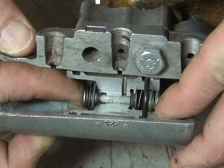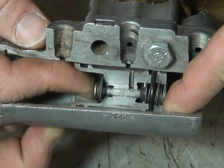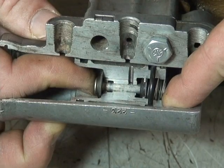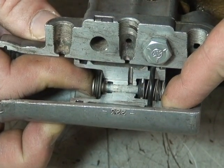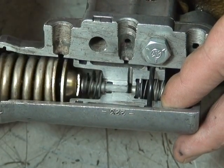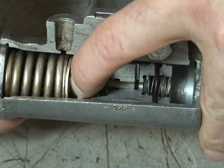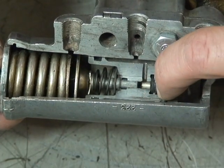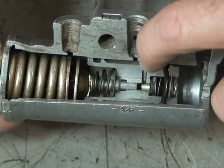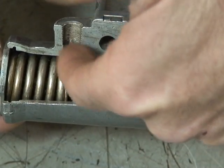Once the air pressure on the back side of the piston — being sent from the supply tank — drops 20 to 25 pounds from cutout pressure, so by 95 psi, the spring now becomes stronger than the air pressure on the bottom of the piston. It will cause the piston to be pushed back down, closing the passage from the wet tank to the unloaders, and opening the passage from the unloaders and the purge valve to the exhaust port via the exhaust stem.